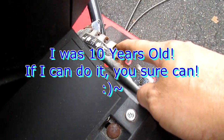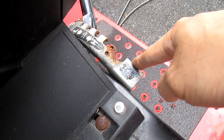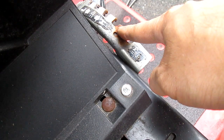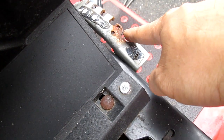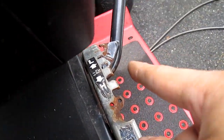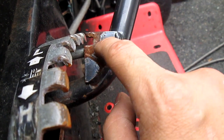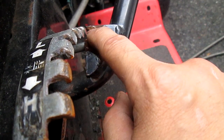Luckily it's still good here. Like I said, the next time I would probably move it one more. Before that, I did put two screws here — you see that? I filed this down smooth and drilled two holes right here. You can actually put a piece of metal here if you want, drill two screws in. But what I did was I put in a hex screw. And that bracket there, I filed it — I filed it even better, so it's actually square this time, not rounded anymore. I think the rounding was causing the issue, but the square won't.